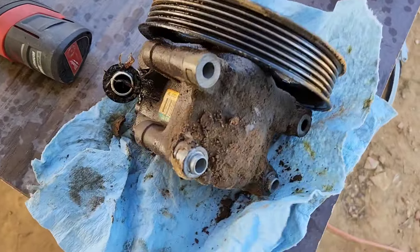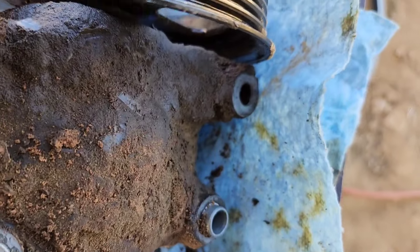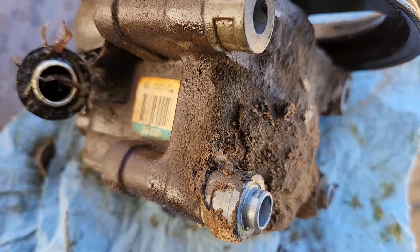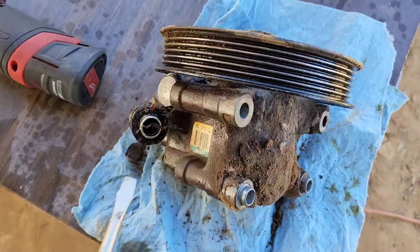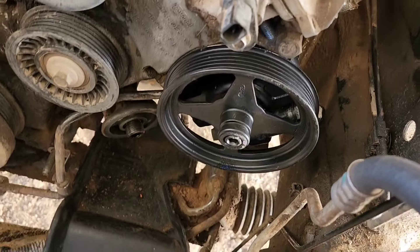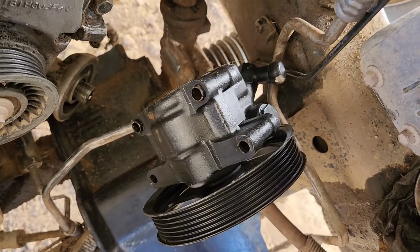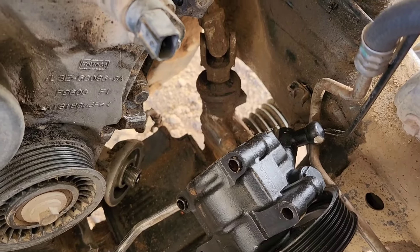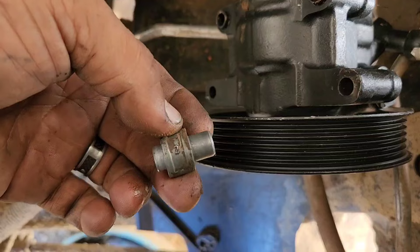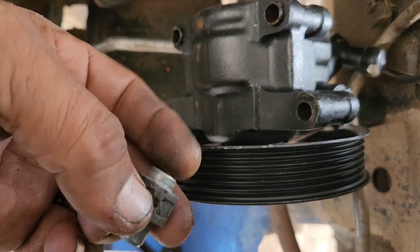I went through the truck and I cleaned a bunch of stuff and fixed a bunch of clips and wires just so we don't do that later. And then I put that power steering pump on and it is such a pain to reach these bolts. I ran all the bolts through and there was still a quarter-inch gap where the pump was flopping around. So I came over here to inspect this and it looks as though there are some spacers on here. I've got to take these off and put them on the new power steering pump, which I already put on. I got the pump off so I can put those spacers in — and there are dowels in here. Yesterday I was telling Mama Bear that this is the worst power steering pump I have ever removed on any of the vehicles I have ever been a part of. So it's kind of crazy that it's just getting worse. Here are the spacers — this side sits inside the power steering pump, and this side sits inside the engine.